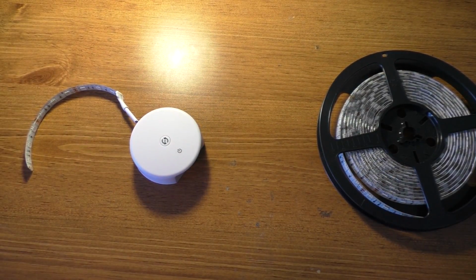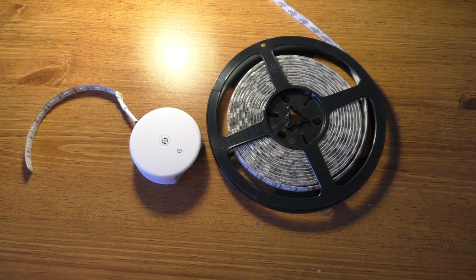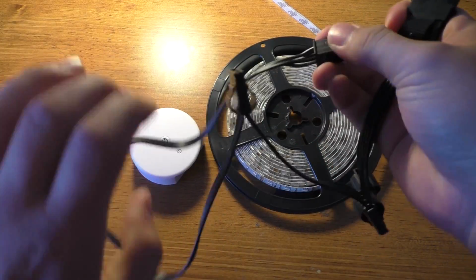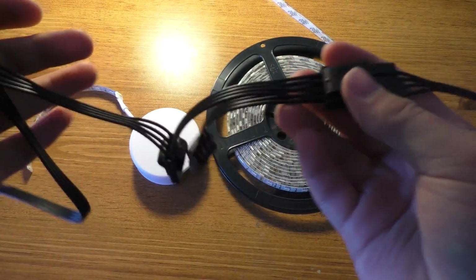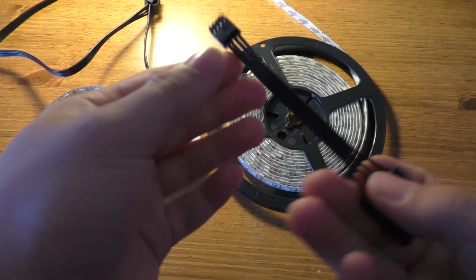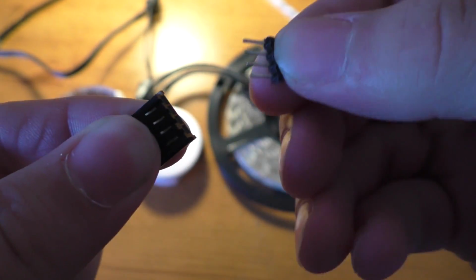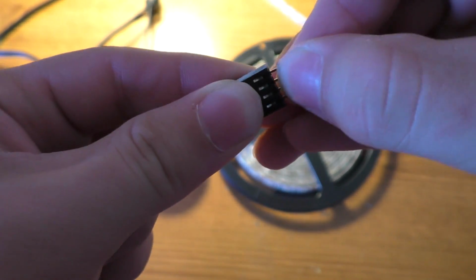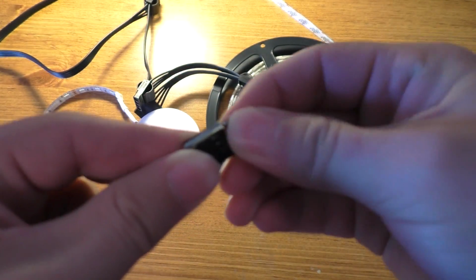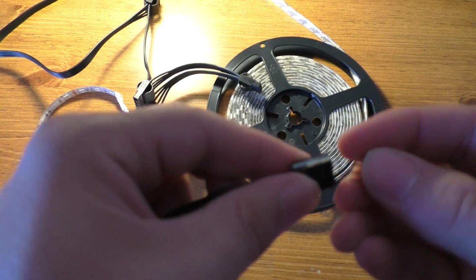Alright, so I've decided I'm going to go ahead and put RGB LED strip on this anyway, even though I decided not to earlier. The plan here is I'm going to put the Molex connector on here in order to get power from the computer, and I'm going to use this little adapter that the computer came with, which I think is actually for floppy drives. The reason why it's so good for my application here is because it takes a standard 0.1 inch pitch pin header, so I can just plug that in right there and use that for power. You have to be careful which way I hook this around though, because if I put it in here backward, technically it won't do anything too spectacular. It'll just give this 5 volts instead of 12 volts, which won't actually hurt anything, I don't think. It just won't work.